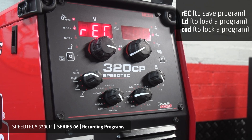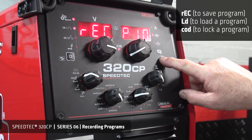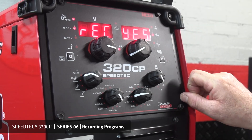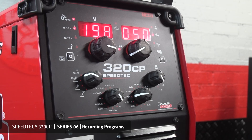To save the program, press the selector button for a brief moment — one second — and YES should be displayed briefly. The job light should now be illuminated, as you are now in the program you've saved. If you alter the program in any way, the job LED light indicator will start to blink, indicating that you are outside the program stored.